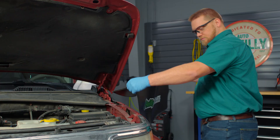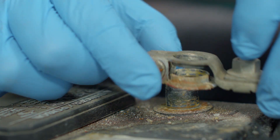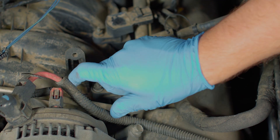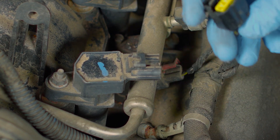You'll start by laying a fender cover across both fenders, or whichever side you plan on doing first. This particular engine is forward-facing, so you'll have plugs on both sides. It's also a good idea to unhook the negative battery terminal. You may need to gently move hoses or wiring out of the way to give you room to get to the coil connectors. Once you have room, unplug the coil connectors carefully.